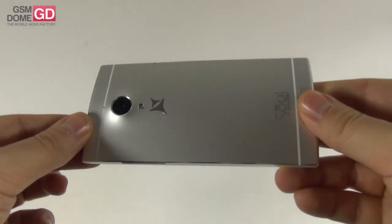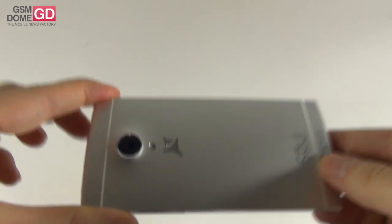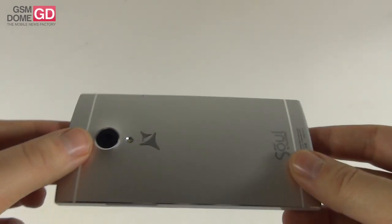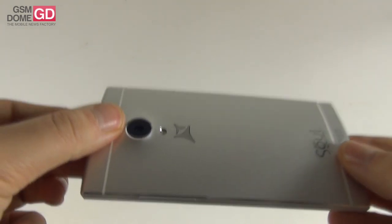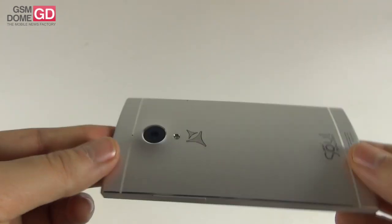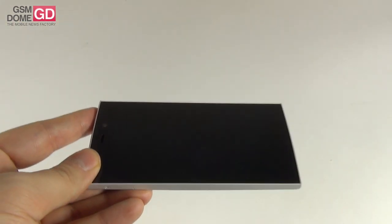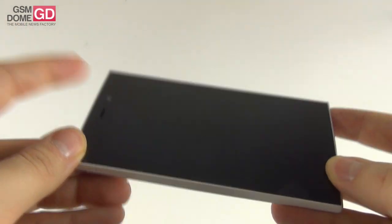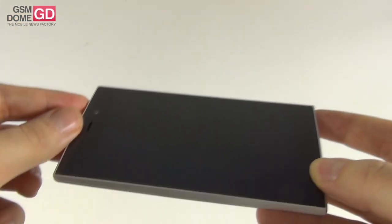As far as the camera goes, you got a 16 megapixel sensor here with an LED flash — this is the Omnivision OV16825 sensor. It has a sapphire lens with an anti-reflection filter, also a UV and infrared filter. This sensor measures about half an inch and was made in 2012. It uses OmniBSI-2 technology and offers 1.34 micron pixels. On paper it's capable of 4K 60fps capture, but only on paper — it also needs a potent CPU to do that. At the front is the selling point: a 4 megapixel ultra-pixel camera with 2 micron pixel size, the OV4688 sensor from 2013, which was used as the main camera on the HTC One M7 and M8.